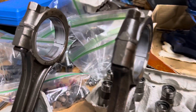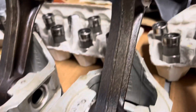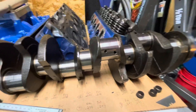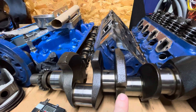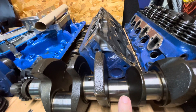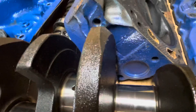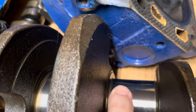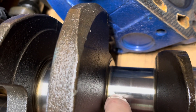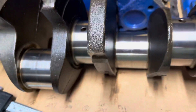The rod bearings don't look so bad and I'm not too worried about that since I'm going to replace them anyway. But piston number three has really bad wear. Here's the front of the crank — you can see right there, I can zoom in a bit. I can feel it with my fingernail — it catches right there. There's some kind of gouge in the crank. I don't know if that happened when they were installing it and hit it with the connecting rod, but it doesn't matter — I'm going to replace these. I ordered a stroker crank.